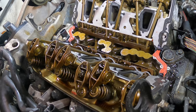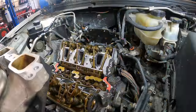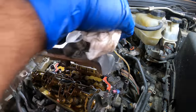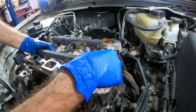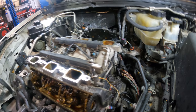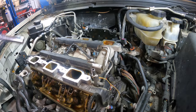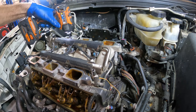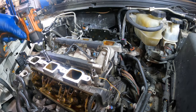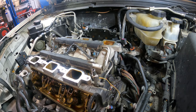Intake set and placed and torqued before the silicone starts to set up. As I said, I already have taken the liberty of cleaning this up and preparing it. And we're just going to maneuver it right in. That's that. She's in place. Okay, I did get replacement bolts, but we'll set the center ones in. And go ahead and run around. They haven't reached bottom yet, but the thread locker is providing some additional friction, but I just want to get them all threaded as quickly as possible.